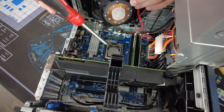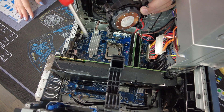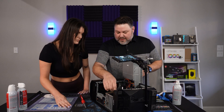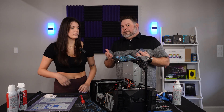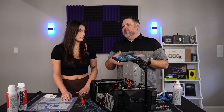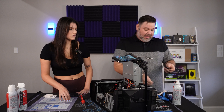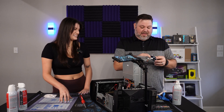Here are your pieces: that's your CPU — it does look like it's an 8700 — your RAM, and this is the heat sink for your VRM, which powers everything. To clean off the old thermal paste, you can use a Q-tip with isopropyl alcohol, or you can use these wipes from Arctic that came with the thermal paste. They smell really strong and chemical.